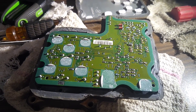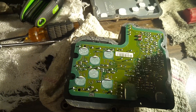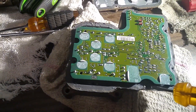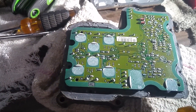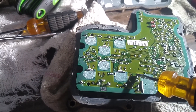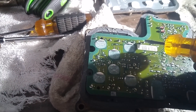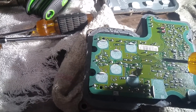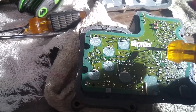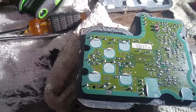I got the cover removed. Be very careful not to crack the board as it comes off — there's thermal paste on it that's a little sticky, and sometimes the silicone gets the board too. From what I've read, these four pins here are the problematic ones, and also this one near the sticker. I'm going to heat up my iron — any of these connections on the relay that are sticking up, I'm going to reflow all of them, and hopefully that will fix the problem.